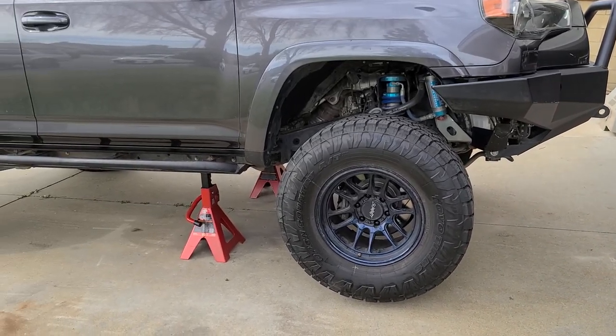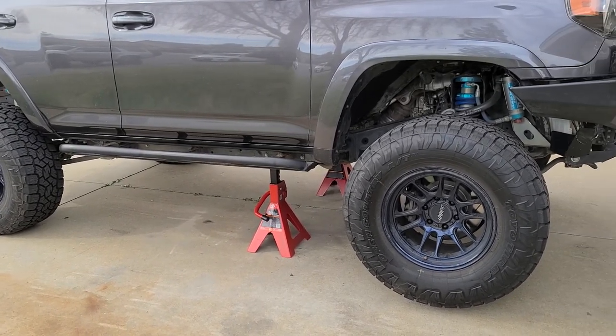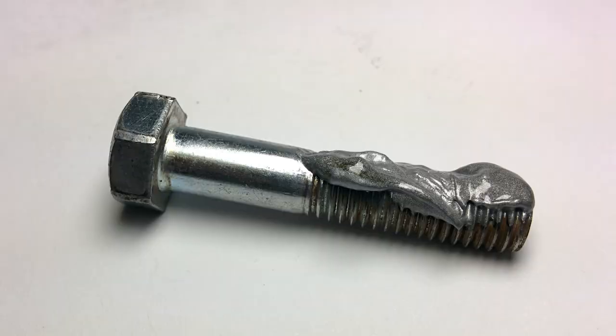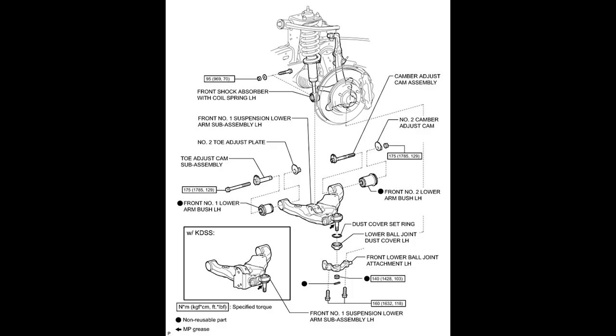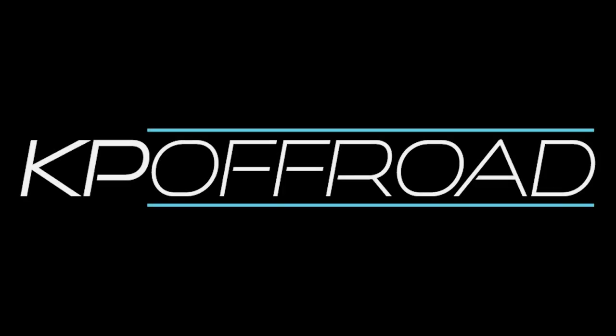Once your new cam tabs are cool, go ahead and paint them. Once the paint is fully cured, install everything in the reverse order you removed it — there are plenty of guides online if you get stuck. Make sure you apply a good coating of anti-seize to all your bolts and torque everything to the factory specifications. We really hope this guide was useful, and if you have any questions about our kit or the installation process, please reach out to us — we are always happy to help. Thanks for watching and have a great day. This install is for educational purposes only and the work should be performed by a shop with fabrication experience.